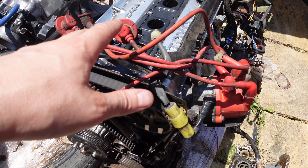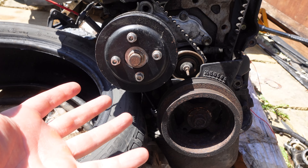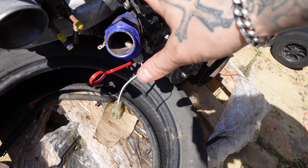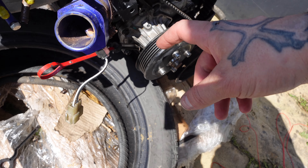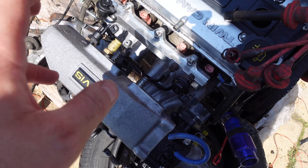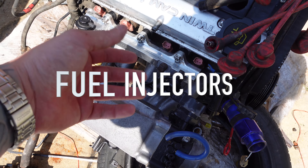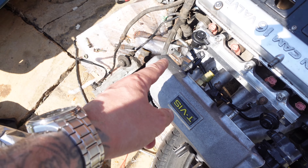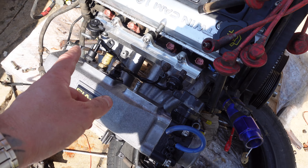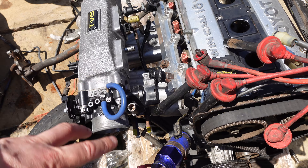I think it might be because the orientation of the engine in the AW11 is transverse. So it might be because of that. The valve covers are all on. We did the water pump - that's all fully sealed, hopefully. We'll double check that when water goes in and hopefully it doesn't leak. There's a thermostat housing - anyway, it's part of the coolant system, all on there now and all sealed up. The intake system is on. We've got the fuel rail on - this is the old fuel rail with the fuel injectors, though they're second-hand.